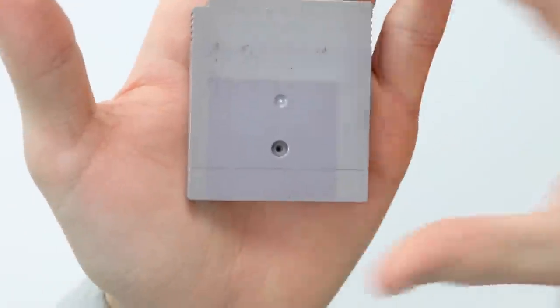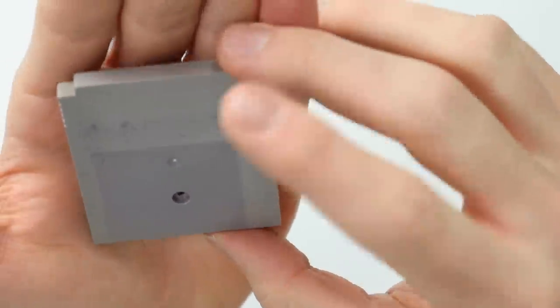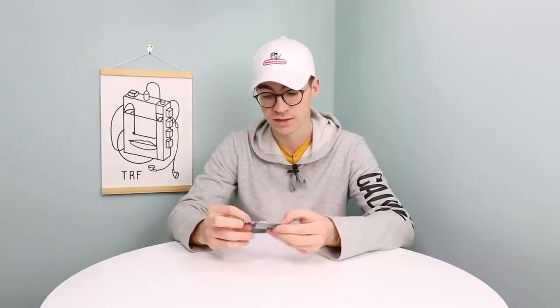When I flip it over you'll be able to see on the back the stain from where there may have been a sticker placed on the back. The writing also hasn't come off as well as I thought it would have done — I tried the isopropyl alcohol but it didn't quite rub off. You'll see there's a slightly brighter area here. I think that's something to do with the fact that this grey isn't quite the same grey as what's on the Game Boys we're used to retrobriting. What's actually happened is it's just gone a lighter grey colour because the retrobriting solution is just bleach — it's just bleached the plastic more than it looks regularly. So it's just not quite the same colour, but you can probably do two of these at once and they definitely look better.